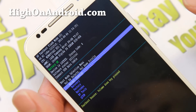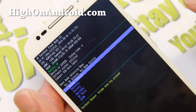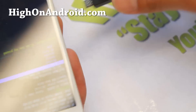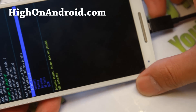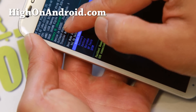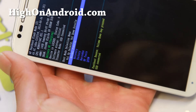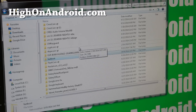Connect a micro USB cable to your computer. You can see it says 'device locked' — that's the bootloader we're going to unlock. Unlocking it will allow us to install custom recovery such as ClockworkMod (CWM) or TWRP recovery. Let's go to our computer for the next step.